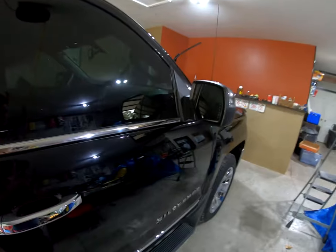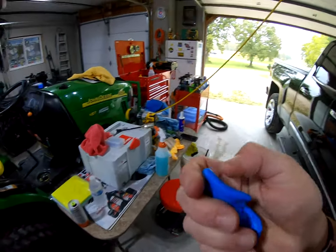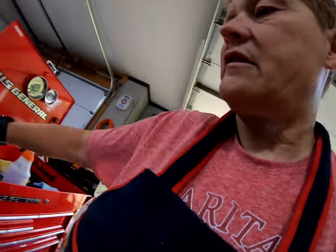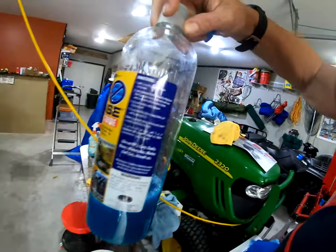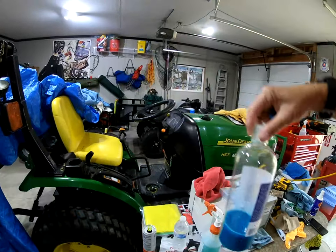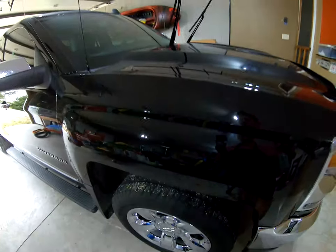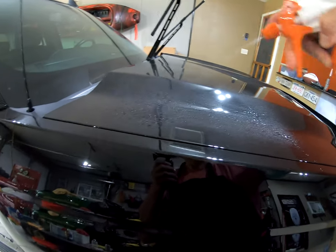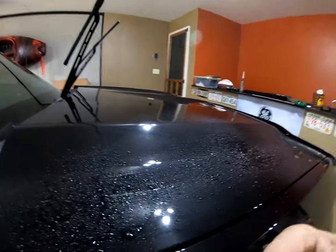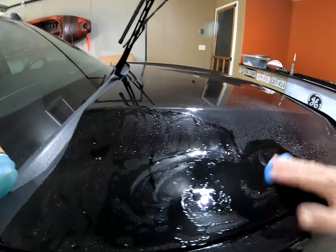What I'm going to work on now — the truck sat overnight from the previous video. It's been washed and dried, and now I'm going to go over it with clay to get all the imperfections off the hood. What I've used is ONR at 1% mixed with water. ONR is a waterless wash, kind of developed during the drought time. I use this as a lubricant to do my claying. This bottle has lasted me a long time. So I'm going to spray this lubricant on here and take this clay — the key is you've got to get a nice piece out. You just want to go over the surface like so, all the way down, and work a small area at a time.